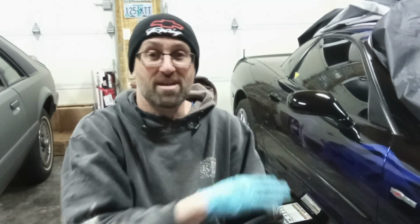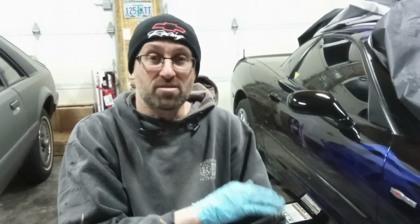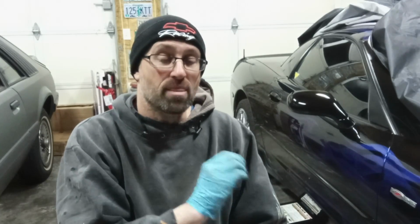Now, on the front edge, like I mentioned, the one that's placed at the front of the vehicle, on the 7000 series, which is the tallest that they make, just be cautious of your exhaust. I think everything else I own, 2 Suburbans, a half-ton truck, and a Fox Mustang, those are all going to be just fine. They are definitely way taller than the Corvette is. So just know for myself to put some blocks under the front tires. That will make it easier to get the Quickjack in and out. But otherwise, it does fit with the 2-inch blocks, the 55 millimeter or the 2-inch blocks will work on the body. The 3 inches actually don't go under the side skirt.